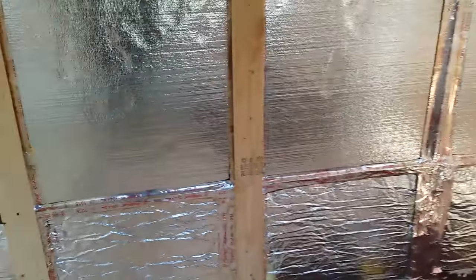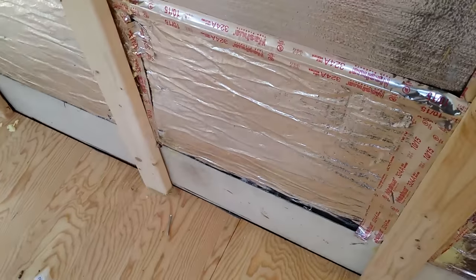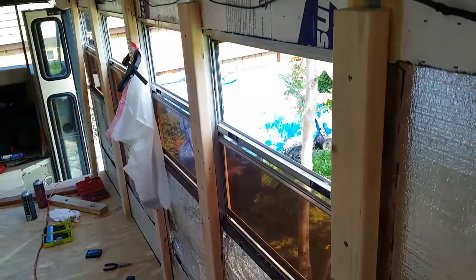After putting in the subfloor, we have started putting the ribs on the sides of the bus. I'm cutting some pieces — these are four foot, eight inches tall. We are wood-gluing them to the side and screwing them in using some metal screws from Tacoma Screw. They're holding down the edges of the wood, and we're also going to be putting some wood glue into that crack — that little seam along the side — just to make it extra snug. We've got five so far in, but every single rib of the bus is going to need it, going all the way around. These are basically the studs that everything else is going to be anchored into, so they're solid, not going anywhere.